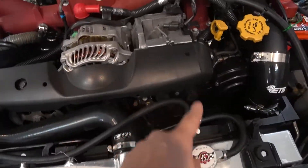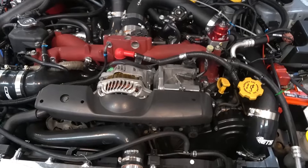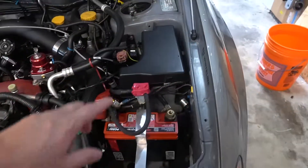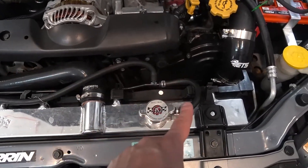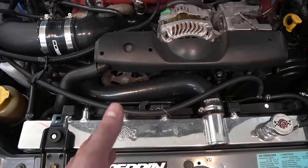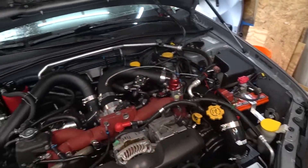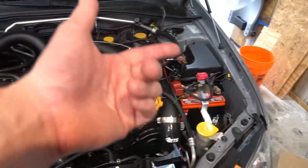The only small issue I've run into right now: so you have two fans — AC fan and engine fan. I never knew that they were different. And under here in the relay box, there is a sub-relay and a main relay. Something's going on with my signal. The AC fan seems to work just fine — comes on whenever I set it, comes on when the AC sets it, comes on at the temperature I set. But for some reason, the engine fan never comes on. What happens is the ECU, at a certain pin, outputs a 12-volt signal to the relay. Whenever the fan's supposed to come on or I test it on, it's supposed to trigger and ground that wire in the ECU, which stops sending voltage and triggers the relay to connect and send power. Well, that's not happening.